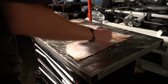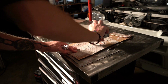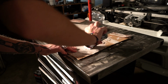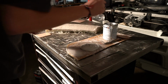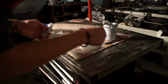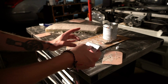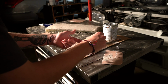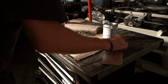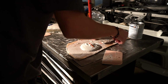We're going in for our second coat of Bondo here. We've waited probably 45 minutes to dry, plenty of time. We're doing the second layer before we start sanding this down. So I think we got the ratios right this time. Baby pancake and 1.5 inches worth of hardener. That looks right. And he said we gotta mix it fast. So let's go ahead and do that.